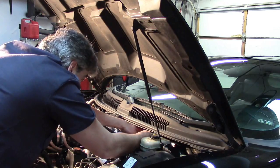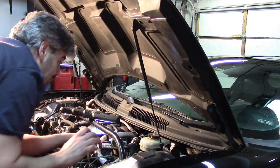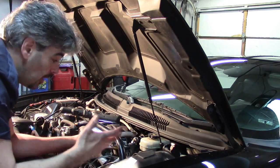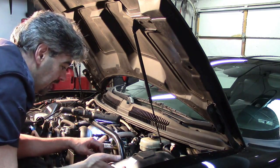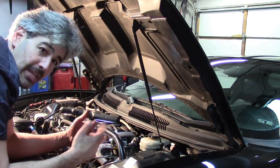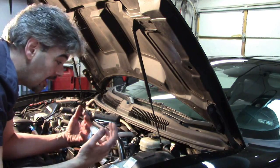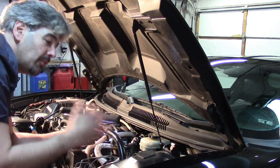It's also important to know that when the air system uses the oxygen sensors to validate, if you have any other existing codes related to the oxygen sensor, you will generally not get an air system code — because it knows the validation sensor is questionable. You may have a situation where you fix a known problem like a vacuum leak, the whole time the car had an air system failure, and the car could come back with a check engine light for an air system code because the code never threw with the pre-existing problem.